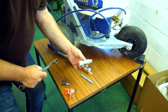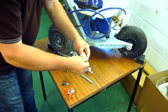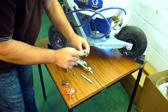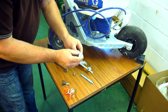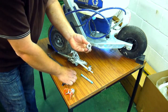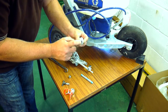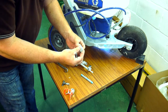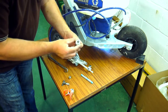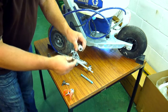One of the problems we've found is in this part of the gun, and you'll need a 17mm spanner just to loosen that off, then it undoes by hand. What we find quite often — although this is clean so you won't see paint build up — in here is a plunger that operates when the machine is under high pressure. It pushes the plunger and the paint is able to travel through these holes and out through the hole in the end of the nut. If you don't clean the machine and paint packs and dries in here, it prevents the plunger from opening and closing, which means no paint will come out, rendering the machine useless. So if this is packed up with paint, undo this nut with a 17mm spanner and get some hot water and give it a light brush with a toothbrush or something just to clean out the paint.